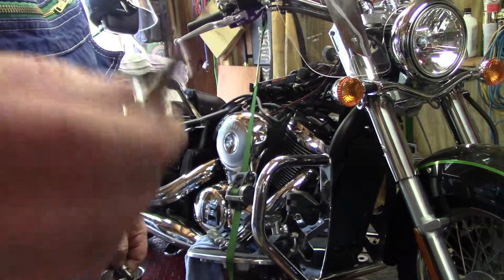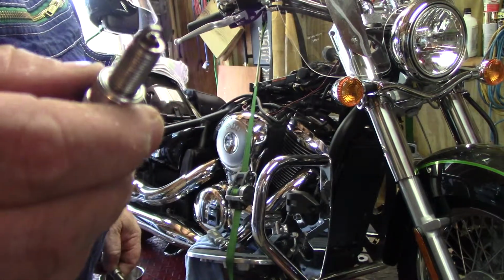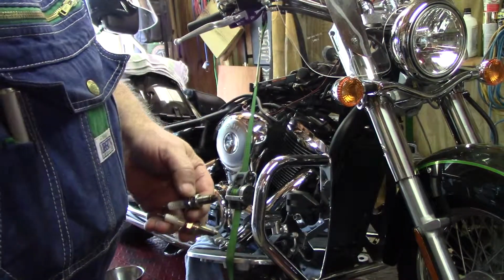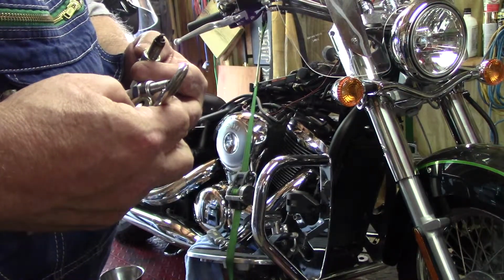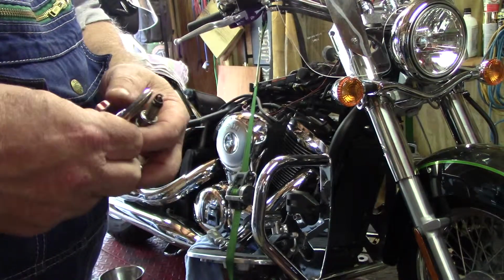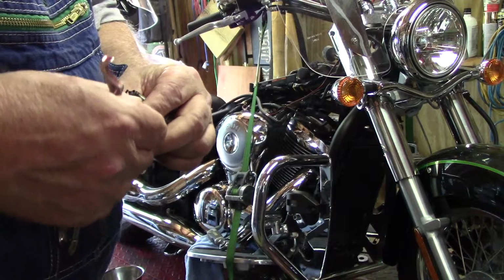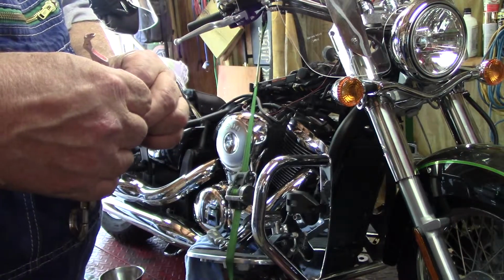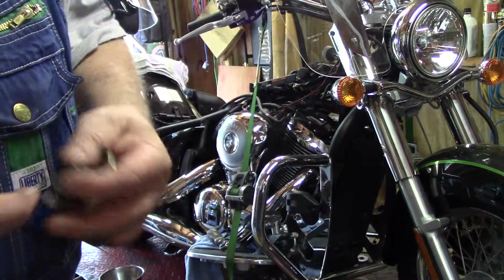I found out online the gap sits at 8 millimeter. Now that's the same as .032 inches. So I set it at 8 millimeters. Not 8 millimeters. What was it? Hmm. 0.8 millimeters. Yeah, 0.8 millimeters. And on that, see, now that's metric. That sets it at 33, and it's supposed to be set at 32. So it's a tight 33, 0.8 millimeter is.